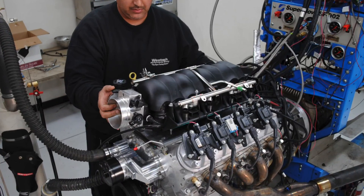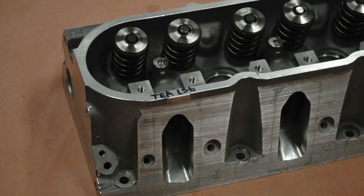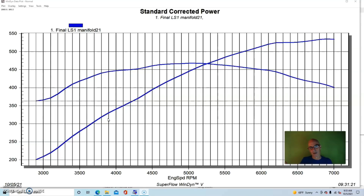To understand why it's not always necessary to upgrade your intake manifold or cylinder heads before putting boost on, we're going to show you the difference between what those upgrades are worth and what just running extra boost is worth. But before we can do that we have to show you what a typical intake manifold test is worth, and the problem is that the intake manifold upgrade is going to depend an awful lot on what you're starting with and what you're ending with.